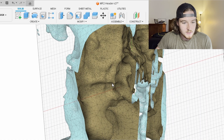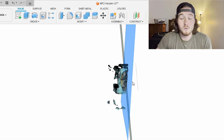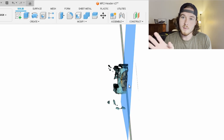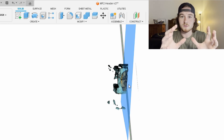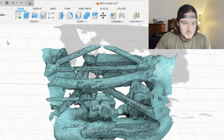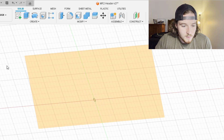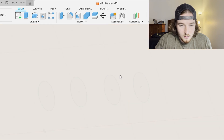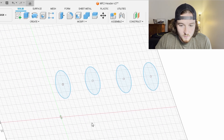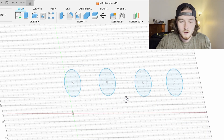Next I had to lay out some planes. The first plane I made is basically the plane that my exhaust flange is going to mount on. I didn't draw the exhaust flange into the 3D model, but I laid out the plane that it would mount to on the head, because ultimately the flange has holes in it and the piping is going to go through to where the flange meets up. Then I started making sketches on this plane, starting with these four holes — basically where a pipe centered with each port hole would start.